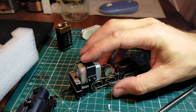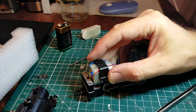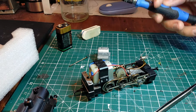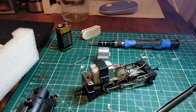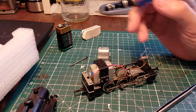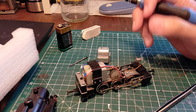With tweezers we'll get rid of all this fluff and gunk. To remove the motor there's a slot-head screw underneath, and that just lifts the motor out. I'll probably remove the motor to dismantle the gear, clean the gear and axle, and add a spot of technical petroleum jelly to lubricate the gear.